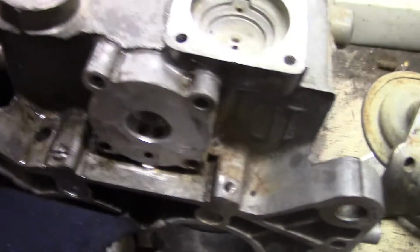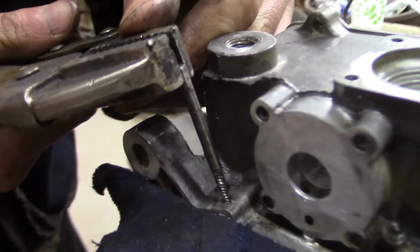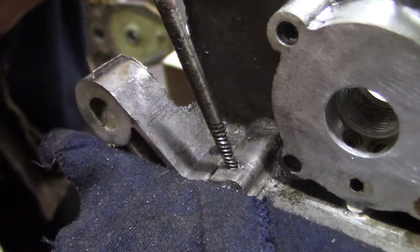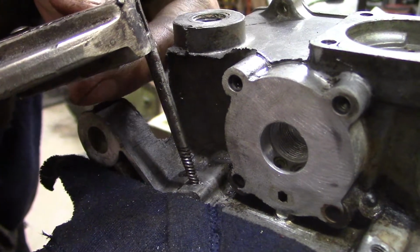Can you cut that a little? Well, see, I was already starting to. I could cut it deeper, but you just go into the aluminum a little bit. The screwdriver didn't work, so we're drilling it out. I'm using my favorite tool in the shop, and by favorite I mean the least favorite. This will make or break this carburetor. What's going to happen is that we're going to shear this easy out in the hole.